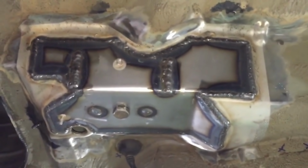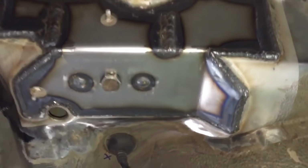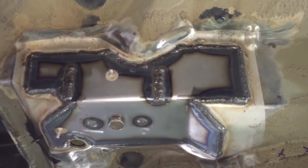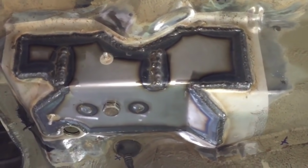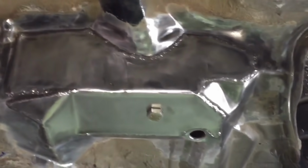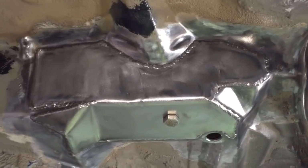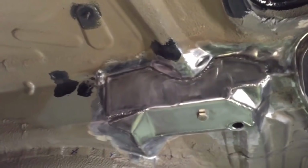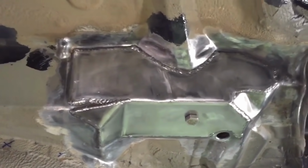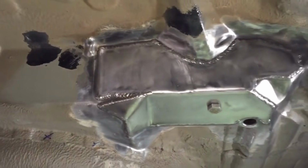Then moving on to the right rear, these two have been welded, plug welded, so we've got a 3-layer multi-connection there. And then the rear ones also have a slot designed to be able to carry out the same procedure but on a vertical plane. And then eventually, once they've been flushed back and cleaned, then you can get them like that. So a fairly neat install. Hopefully OEM looking, most people would tend to agree, especially once we've got our multi-layer corrosion protection and sprayable seam sealer on to blend into the BMW factory textures.